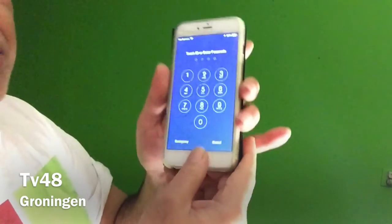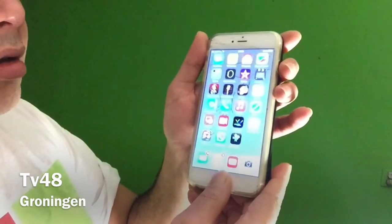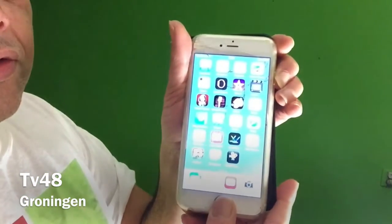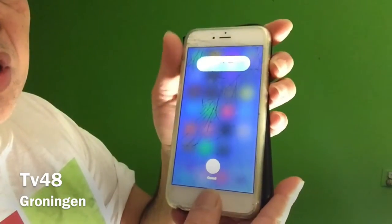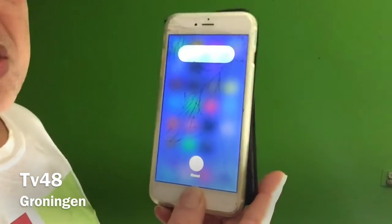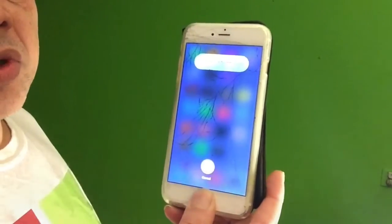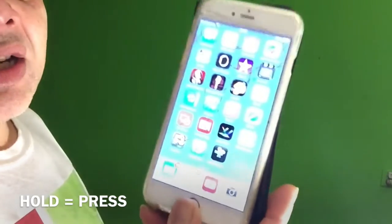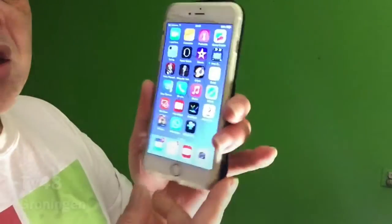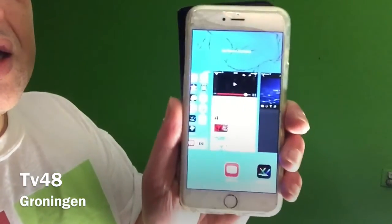Make sure you are on your home screen, then press the power button and wait for the power-off slider to appear. Then hold the home button for a couple of seconds until you get back to the home screen. Now we've freed memory on this device.